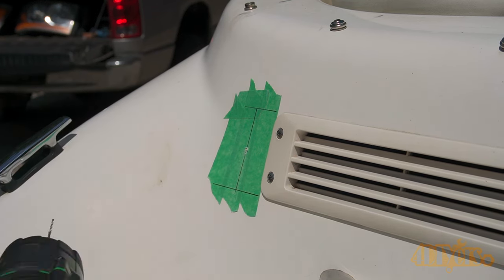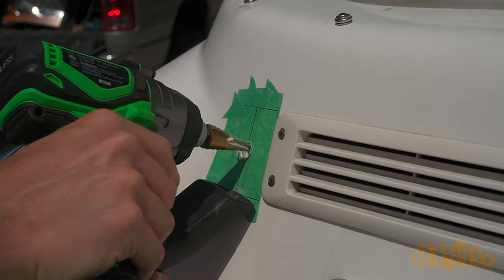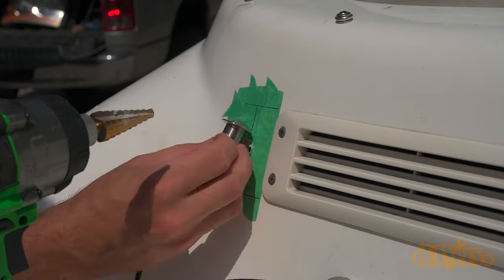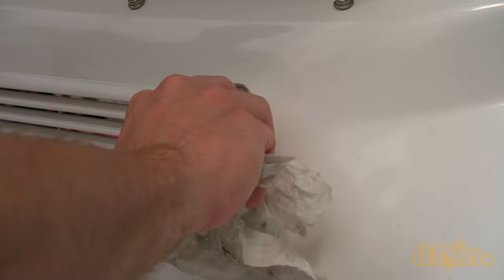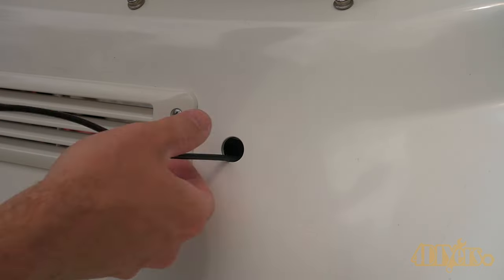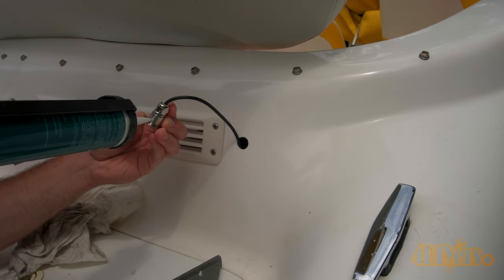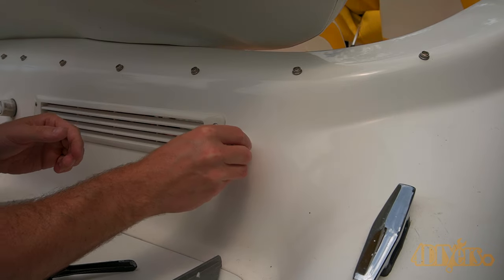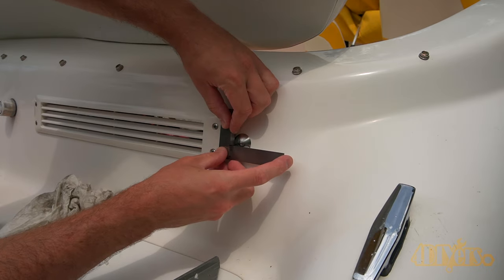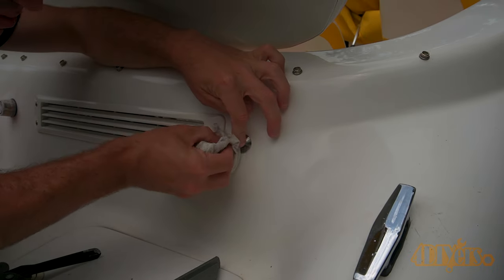Start with a small drill bit first as a pilot hole, then a step drill is used to finalize the hole. For these, the lights require a 5/8" hole. A step drill tends to leave a very clean cut. The holes are cleaned using a vacuum to remove any dust. The back side of the lights and the hole surface are cleaned with a wax and grease remover. Each light is glued into place with a white marine adhesive, applied around the perimeter and firmly pushed into place. The position is checked to ensure it is square, and any excess adhesive is cleaned up with a paper towel and acetone.